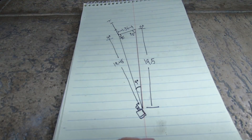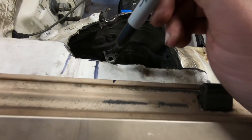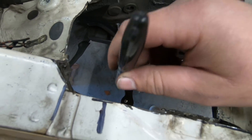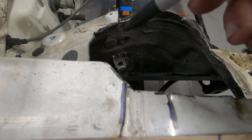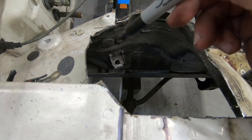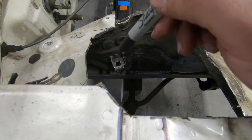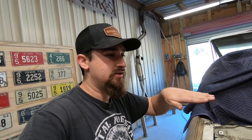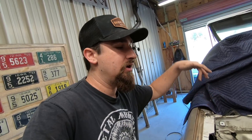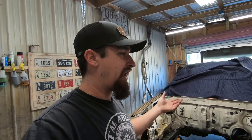Now I have to implement that into building out the tops of the shock towers. I made the original mark straight up — 90 degrees — and then this is our new mark: 1.36 inches back from there. So this is exactly where the center of the shock has to sit. The old Accord shock sat over here; the new one has to sit right here. That top plate can't be at zero degrees either — it has to be at the negative four-degree angle to match the caster. Usually my videos don't get into numbers like this, but this is just what you have to do when building a car from scratch with nothing out there for this specific swap.